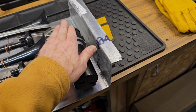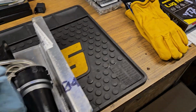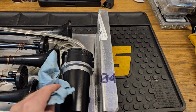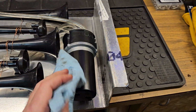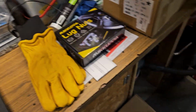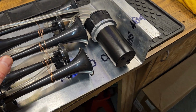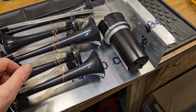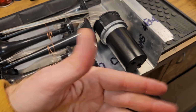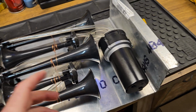And this thing drags pretty hard, just so you know. It's a power hungry little bastard, let me tell you that. I don't know if there's some friction going on inside there, or it just has that much compression, like it's really pushing hard to get air out, or a combination of everything. Obviously with an air compressor, you pour oil in it to keep the cylinders from self-destructing and overheating.